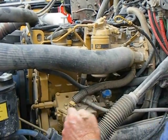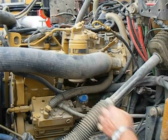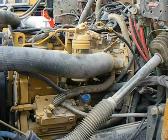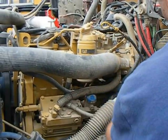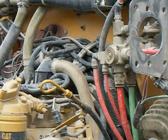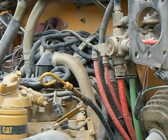This one here is gear-driven. This component right here is the air governor — it allows the air compressor to cut in at 100 and cut out at 125. We're going to look at our air lines and all the electrical lines, make sure everything is in good shape. No apparent leakage, no wires rubbing together.